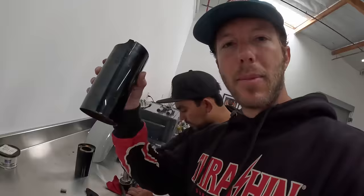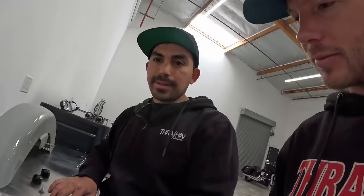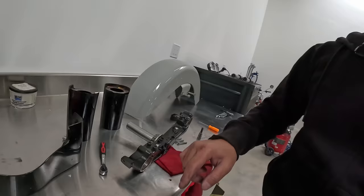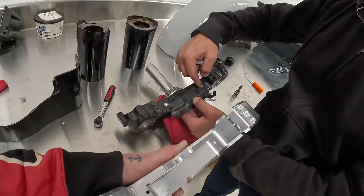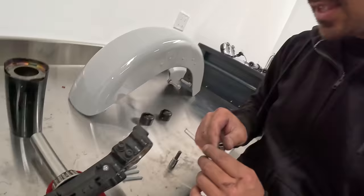We removed the cowbells — we won't be using those for the new tree. We will keep the front eyebrow chin spoiler piece because it holds the brake lines — one for left, one for right — and our tree has threaded holes to accept those two screws. But first we need to steal the stem and bearings. Those bearings look dirty — need some fresh grease. This bike has got like 30,000 miles on it, and I've ridden it to Sturgis three times, up and down the coast.